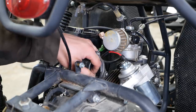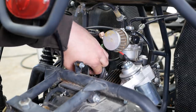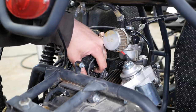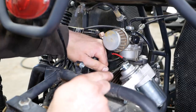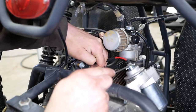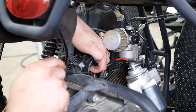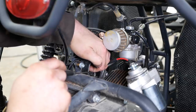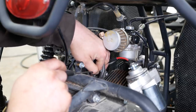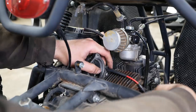All right, folks. I got interrupted several times — I had to do an insurance audit. Anyway, I pulled the starter off. I believe it has been replaced, and it's got a sprocket on it — it's a chain drive starter. If you look right here where my finger is, there's the chain. I don't believe the chain was ever hooked back up, so it was just freewheeling in there. Or if it was hooked up, it threw it off. Anyway, that's only part of the problems.